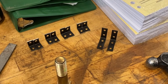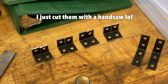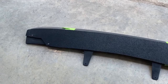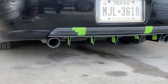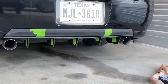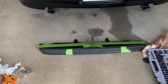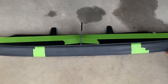Once that was finished I did a little custom fab work on these brackets since I couldn't find any that were black and shorter. Then I went back to the storage unit and drilled holes for the mounting screws and threw it on the car to see if it would clear the exhaust — and it did. Next I threw the piece together with some tape to see how it would look when mounted, then put a piece of tape on the center of the rear bumper to get an idea of where center was, and afterwards used a tape measure to confirm everything was lining up properly.